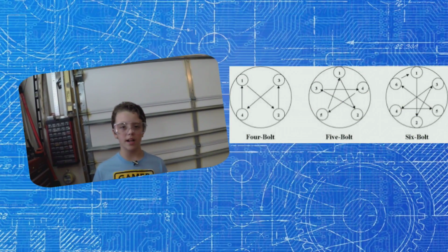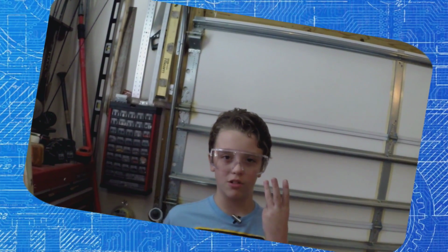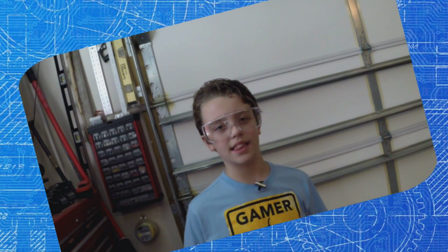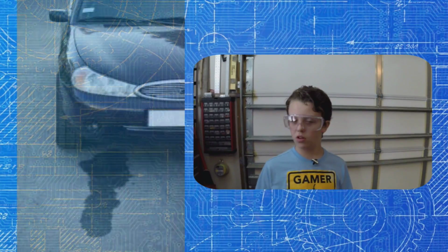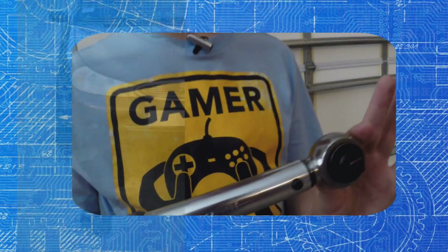Divide the torque by 3 and do a crisscross pattern. Do this 3 times to reach full torque. Give it a few more passes at this setting and it's good to go. If you do this, you don't have to worry about doing the job again due to leaks.